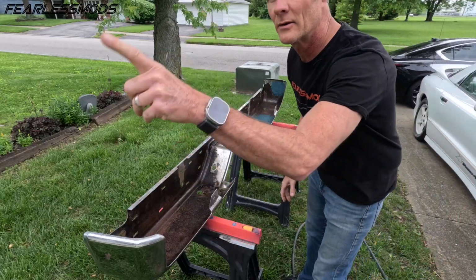Going back and looking at the footage, it did turn it a darker color, so I think for the most part it has done what it's supposed to do. And anywhere where we have bare metal, this stuff is direct to metal anyways, so I think we're gonna be good to go and just help put a really good epoxy coating on the back of this to protect it long term. Okay, I hear thunder over there.